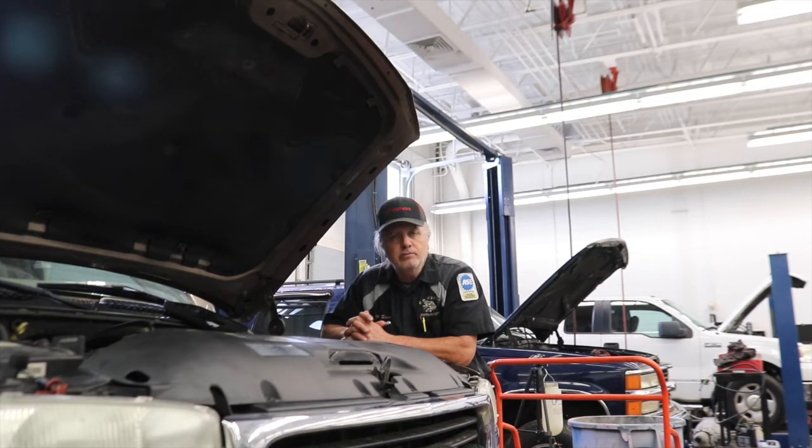When we were turning it over, we could hear a hard knock coming from the bell housing area behind the engine. So the first thing the students did was attempt to diagnose something in there. Flex plate bolt, torque converter bolt possibly coming out and wedging in the webbing between the back of the block and the flex plate. It's happened before. It's kind of rare, but it does happen. But they were then quick to figure out that the problem wasn't actually coming from there.